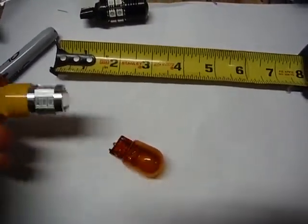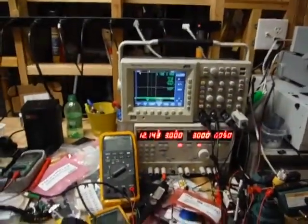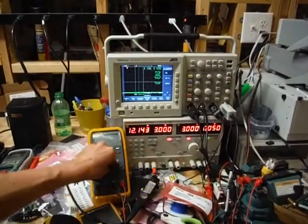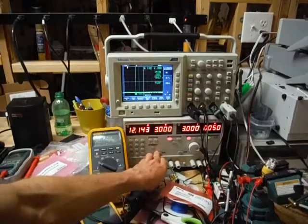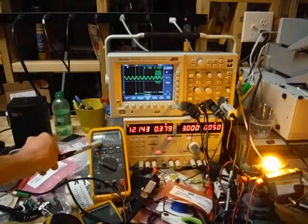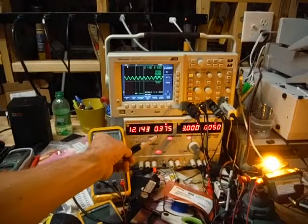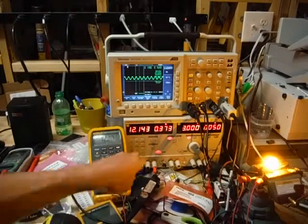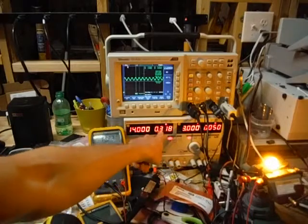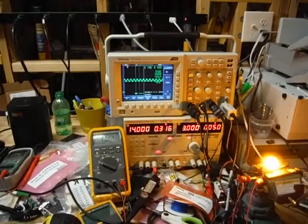There are three facing out, and I threw it on my bench. I'll go through that real quick just to see how they performed. So this is 12 volts right at the bulb — 375 milliamps. But if I go up in voltage, the current is actually going to drop, because there's a buck converter in there regulating the current for the LEDs.